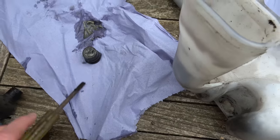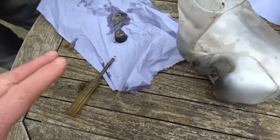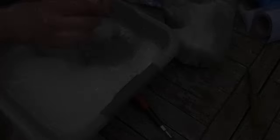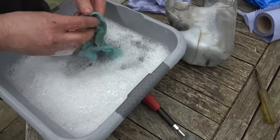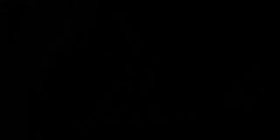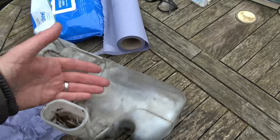We're obviously going to give that a good cleanup and put the hosepipe in here to clean everything out. The motor itself I think is going to be just fine - I'm not even going to get the bench power supply out because it was making the right noise; it just wasn't able to suck anything up because this had stopped the water flowing through it. We've got a bowl of warm water with washing-up liquid and we're cleaning up the gauze. Without that gauze the washer nozzles would get blocked constantly. You can actually blow through it so it draws air in to allow the water to flow.